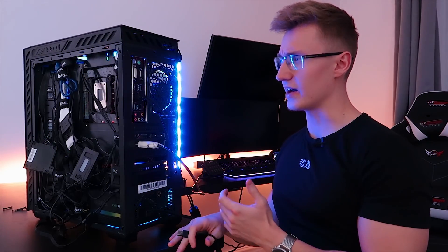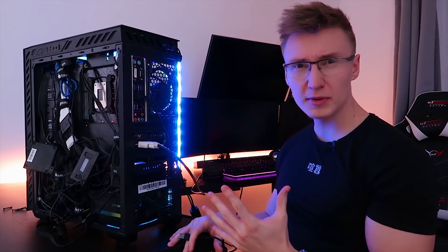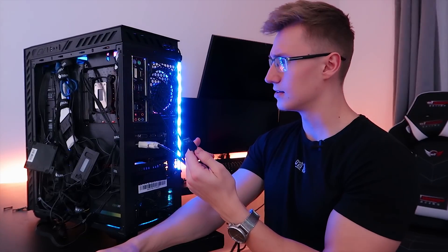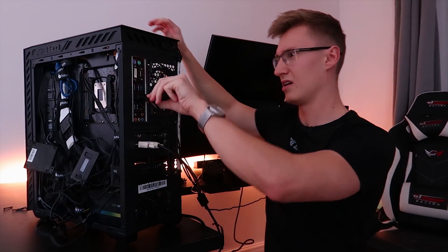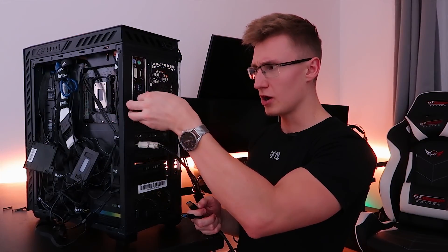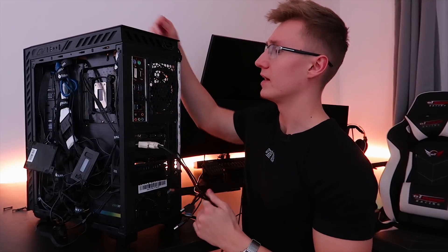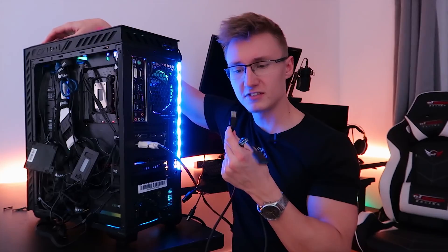So I've learned one thing so far: I don't know if this is actually fixed, but these two USB ports for my keyboard seem to be working fine. I'm able to have these two plugged in and the PC still boots up. What happens if I try to plug in my mouse? So now three USB ports. Oh, is it the mouse? Is the mouse at fault here? Because the keyboard works — at least those two ports work. Could there still be a power supply problem with the 5 volt rail?